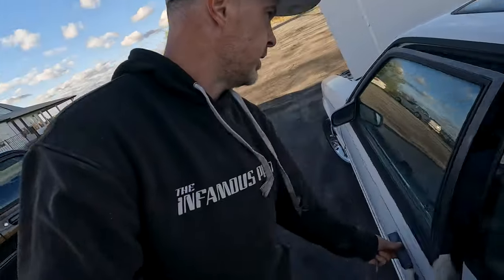Moment of truth. Man, I cannot believe that wind, guys. It is just unreal today. So now's the moment of truth to see if this thing's gonna fire up. Remember, this is a freshly built motor. So we have our top dead center found, distributor in pretty much a good relative place for an initial startup. It's not like we're trying to run 14 degrees of timing or anything like that. And all of our electronics work, check that out.